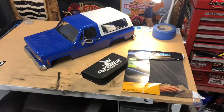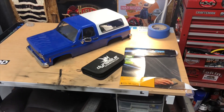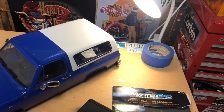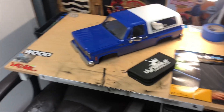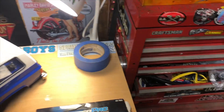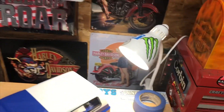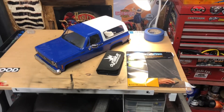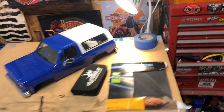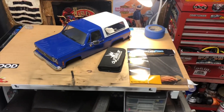Alright YouTube, just seen the intro with me and Nitro J talking about the Rubik's Cube, and here we are another day. We're getting ready to start prepping this guy out. We're gonna remove all the trim work that we can, then use some 600 grit smoothing sandpaper — you guys saw that in my last video. I'm going to mask off the stuff we're keeping blue, lightly scuff this thing down to knock the shine down, then throw some adhesion promoter and primer. Then we're gonna start Rubik's Cube 2.0 — recreating the masterpiece.